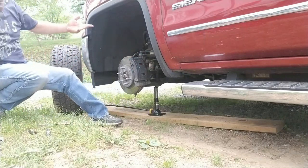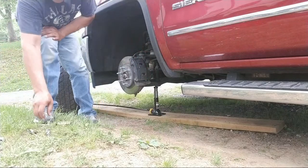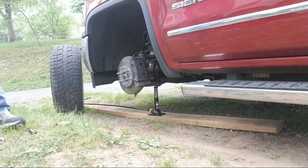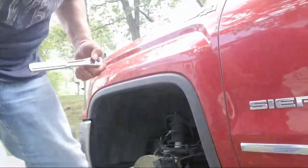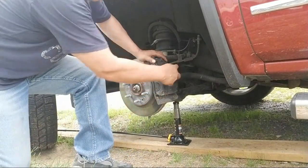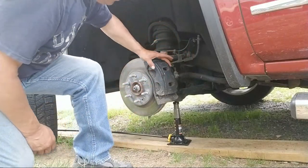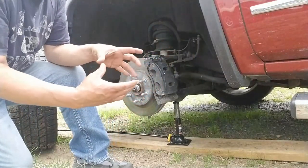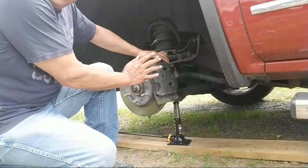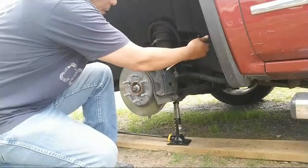So what you just saw me do with the wrench. There's two pistons, or a piston back in the backside here, and that's what pushes your brakes closer together to tighten up around your rotor. The caliper always keeps it at a particular tension. I was reaching in here to pry because I'm pulling the face of the caliper out with the piston still shoved behind the rotor, using the rotor as leverage to open the caliper up.